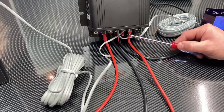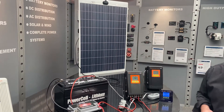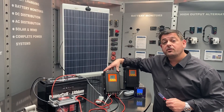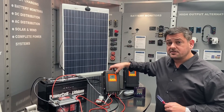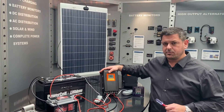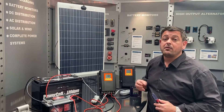You'll also notice two other small positive and negative wires, and you may have noticed the solar panel. This is one of our semi-flexible solar panels suitable for use on an RV, a work van, or on the coach roof of a boat — they're designed to be walked on. This is a 100-watt panel. Built into the DC-DC charger is a maximum power point tracking solar regulator. That regulator can deal with solar panels of up to 500 watts, so you can put quite a large array on the roof and the DC-DC charger will look after that as well. It means it's one less box, one less piece of electronics you've got to fit. This unit will sit there and manage the power from the alternator to charge the auxiliary battery, and also the power from a solar panel.